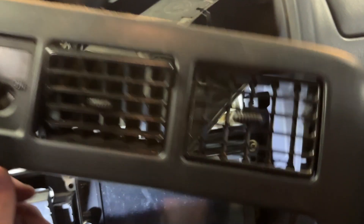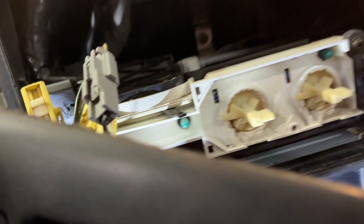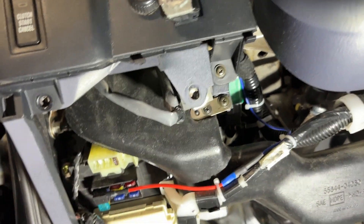It's going to come out like this, and your AC vent piece might fall down — that normally sits up here. You can disconnect these or just leave them hanging for now. Once you get that other piece off, you've got to take out this Phillips screw right here.